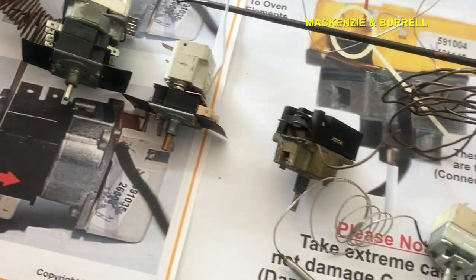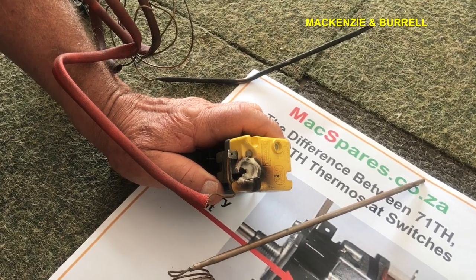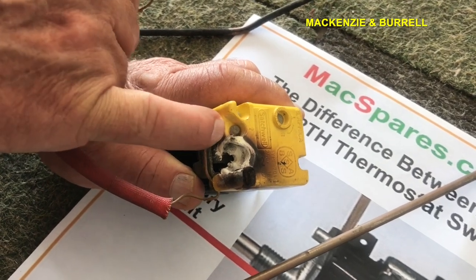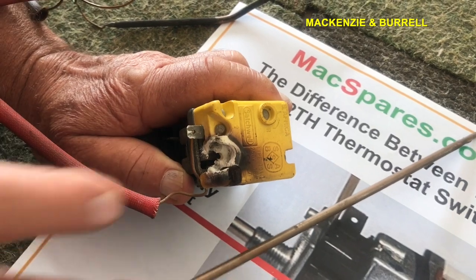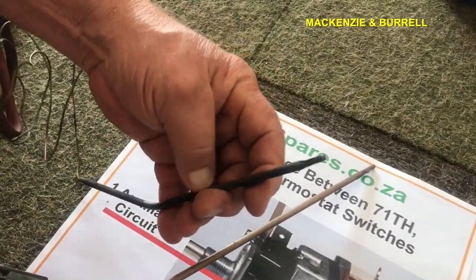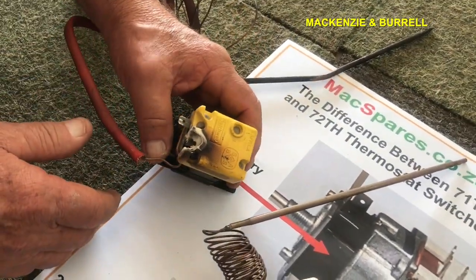If you open the door and lose a lot of heat, dropping below the set point, both elements come in automatically to recover the temperature. You can replace this with a 71 quite easily. Now, before we go, let's talk about what destroys thermostats. Here's a good example of a thermostat with a hot connection. These thermostats carry quite a strong current. In this case, a push-on lug worked its way loose — through too much current, age, or whatever — and developed a hot connection until it finally burnt away the thermostat. That's a normal fault we find. Either your capillary will leak out, your diaphragm will become weak and not control temperature correctly, or you get connections like this.